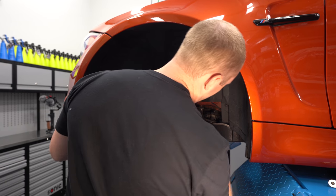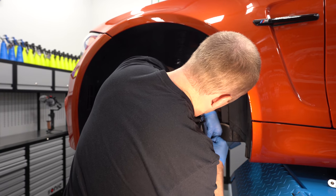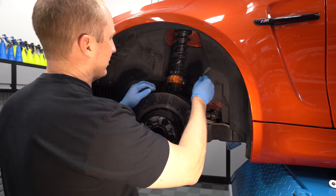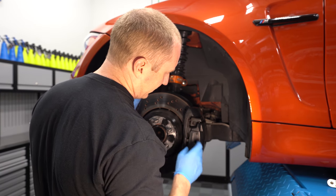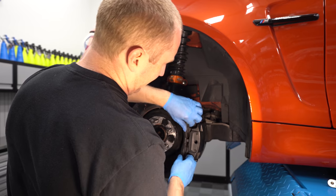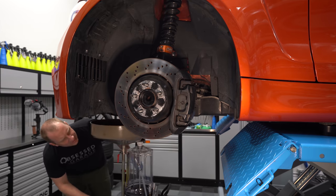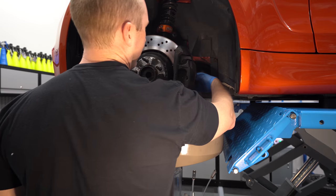Step one, so you don't mess this up: pull out the wear indicator, which we're going to essentially short. This car has a wear indicator in the front driver's side and the rear passenger side — don't let me forget that; we'll have to terminate it in a bit. This piece has to come off first. We'll bring the car up and get the can underneath here.